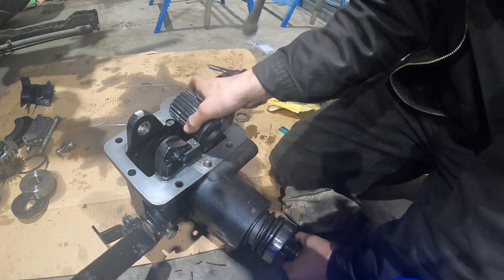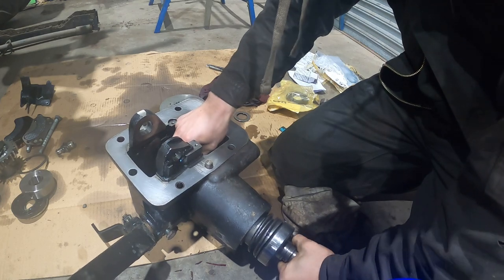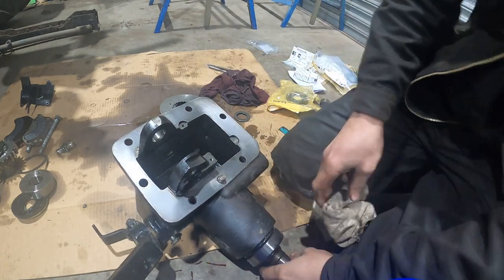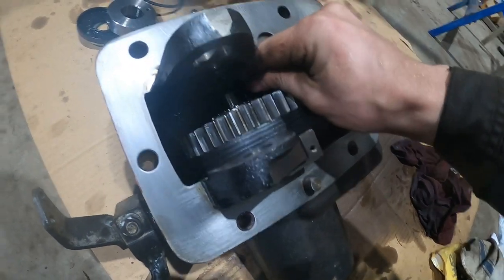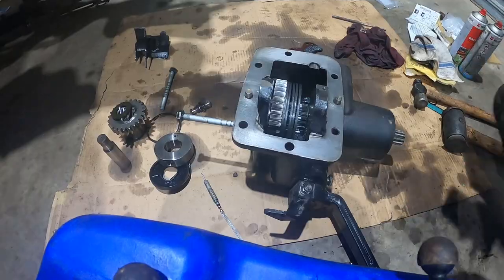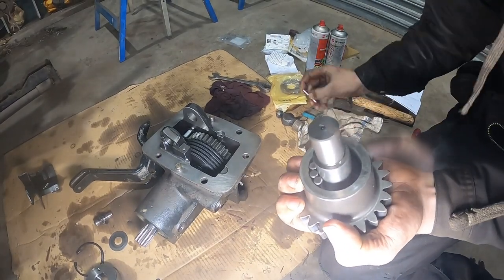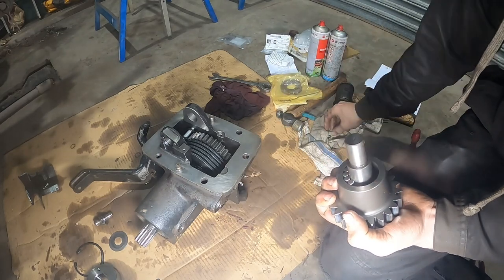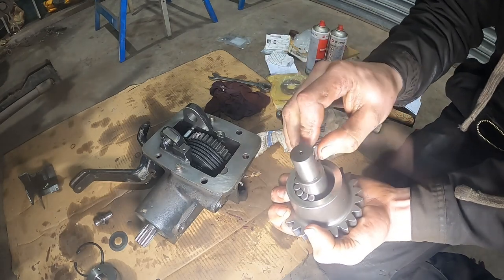We're on with the reassembly now. I don't need to order any parts because the bits were in the bottom — I've just ordered a couple of seals. We've got the spline in, shoved the shaft in a little bit, lined up the intermediate plates, put the gear on, and now I'm putting that all-important thrust washer back where it belongs — confirmed by the parts diagram. I've got the shaft in and I'm putting the handbrake pads back in, then putting the idler gear back on. You have to get the shaft, the gear, and then there are little rollers — not a bearing insert, just rollers that you assemble yourself.